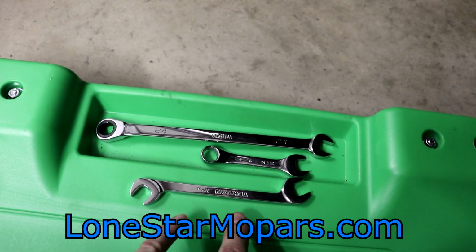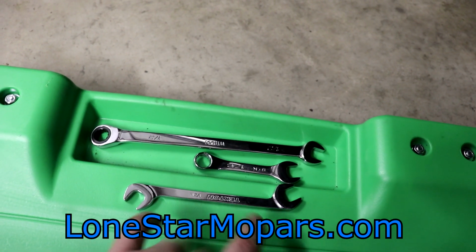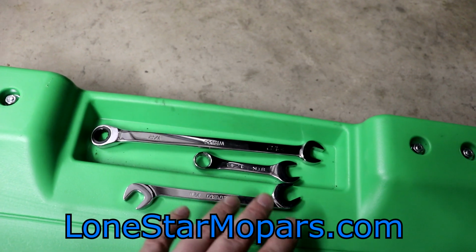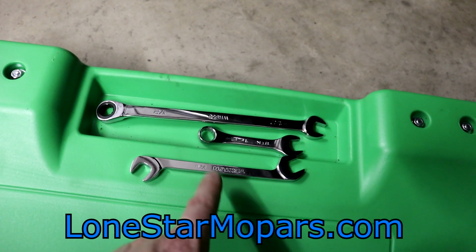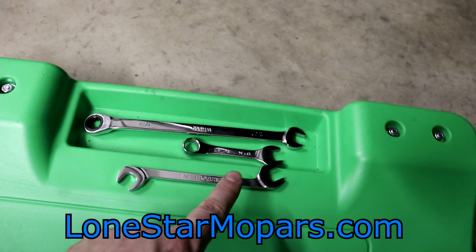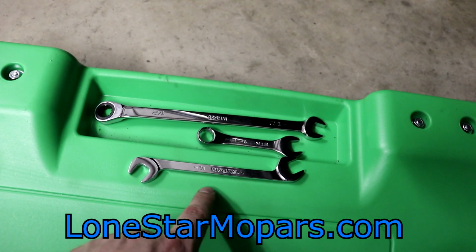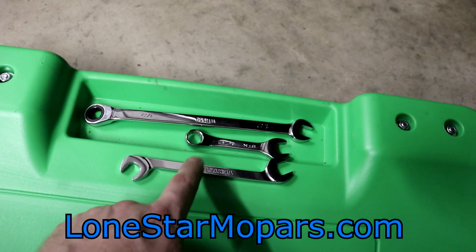So we might buy one and make it ourselves, and I might do a couple other sizes. Again, I didn't buy a full set of these ever. I think 7/16, half, and 9/16. Sort of covers quarter, 5/16, 3/8 hardware, where I thought that I would use these, and that's what's happened. But this Stubby is just a little too long. What happens, you can catch just fine, but then you hit the primary as you're tightening or loosening. And I've done both because, again, we had to pull the passenger header off to get a bolt out. Still can't quite believe that happened a day later. But yeah, I may make one of those, so stay tuned.